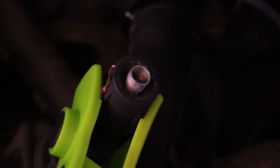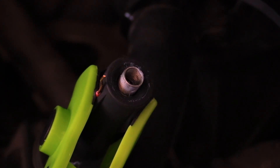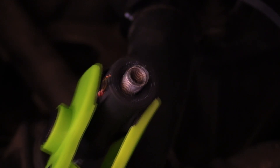I've turned off my studio lights so you can very clearly see the spark if it happens. If it does gap you'll see a nice big spark from here to here and you know the ignition system has spark, so spark isn't the problem. Now before we test this it's important to keep your fingers away from anything — you really don't want to get shocked. It's not the end of the world, you won't be seriously injured. It's about 25,000 volts but the amperage is ridiculously low, so it'll sting but won't cause serious damage. The idea is to stay away from it — that's why we set everything up with the clips so you don't have to hold anything. So let's go ahead and try it.